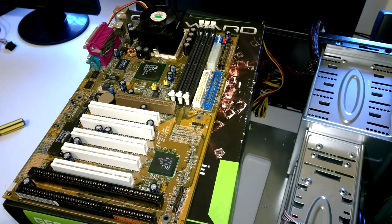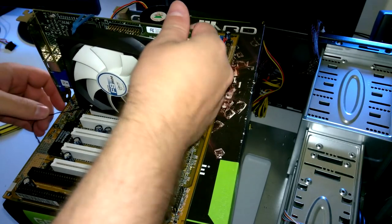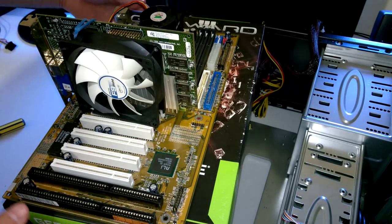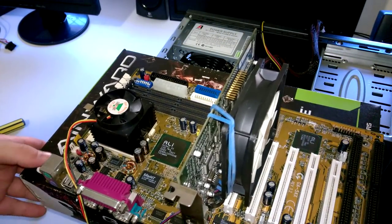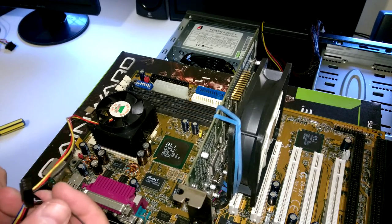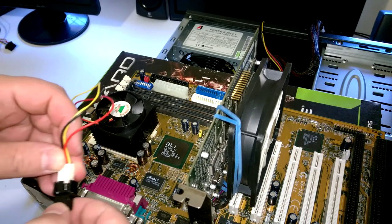At this point, I want to talk about the graphics card. I'm going for a 3dfx Voodoo3 3500, the RGB version. One downside of this card is it runs very hot. So I've done a little mod and I've done a video that shows you how to do it. I'll put it down in the description. It's a nice 80mm fan, keeps the card nice, cool and quiet. And because I have to do some cable management with the fan cables, I'm doing that right now.